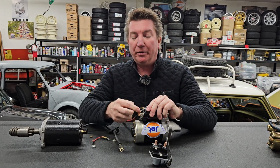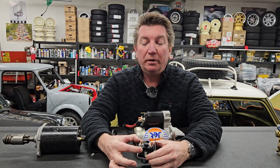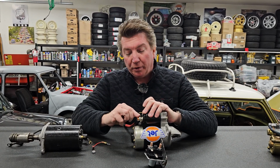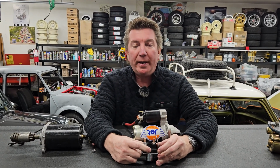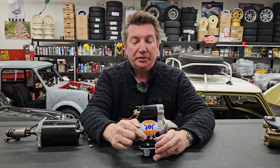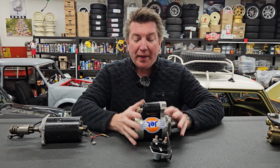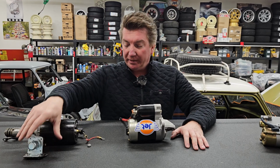You're going to run the 12-volt power source directly from the battery, directly to the back of the starter. You're going to take all the brown wires off of the 12-volt battery source. The brown wires are 12-volt constant directly to the battery also. They're all going to go on the back of the starter. So all your brown wires, your 12-volt battery, all goes to the back of the new starter, and then you take this little spade terminal, has a white and red stripe. That's your key start. That is when you engage the key, that sends the signal to the starter to start. So you're going to extend that wire all the way to this spade terminal on the back of the starter solenoid, so that when you turn the key, boom, away you go. So if you do it that way, you can delete this, it's gone. Your wiring gets all tidy, and there's one less thing in the engine compartment to help clean it up.